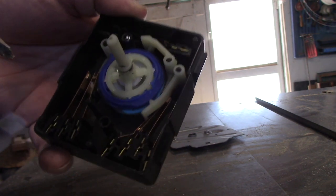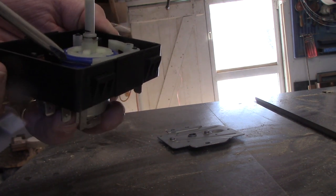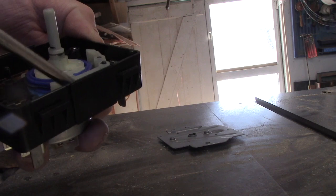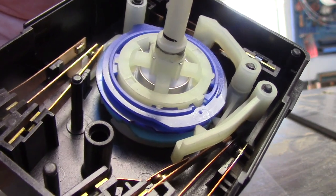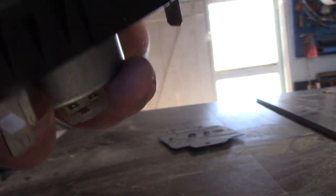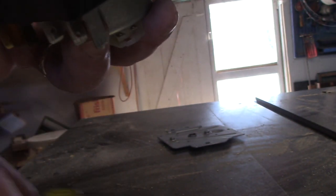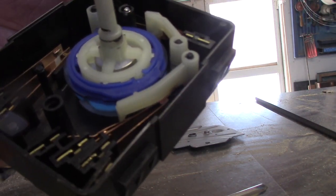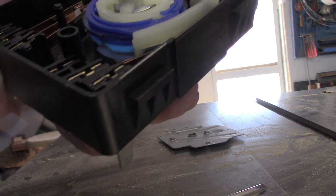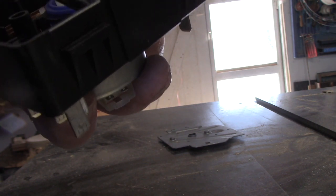You know, this still might not be the problem. It's just, this was the problem last time. I can tell you that those contacts, when I take them out into the bright sun, are really toasted. Almost like a granulated sugar, a metallic granulated sugar, a charring. They are heat discolored, which shows that they have been heating up, which probably means that the resistance is climbing. The more resistance, the more heat. And, you know, arcing and pitting of the contactors does increase the resistance.